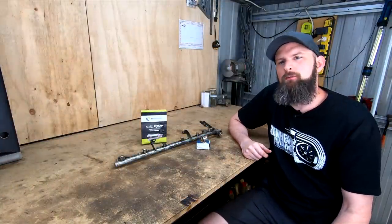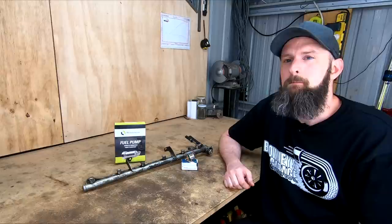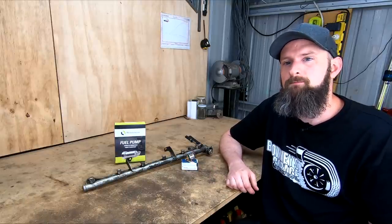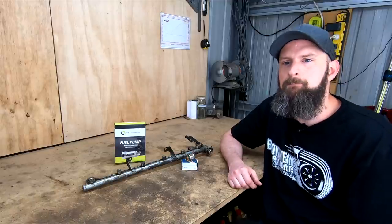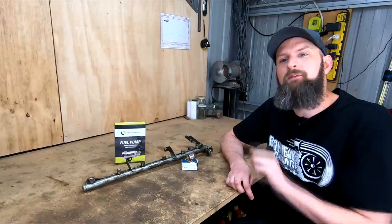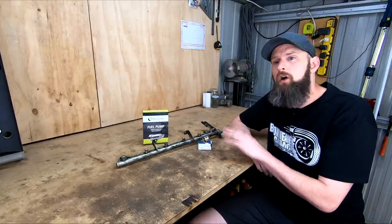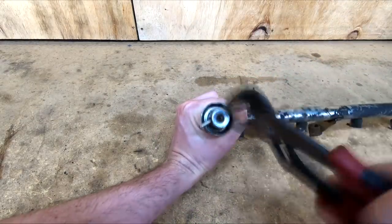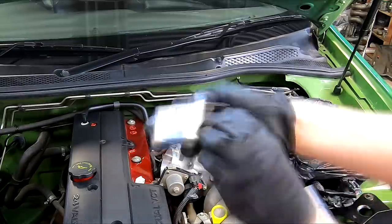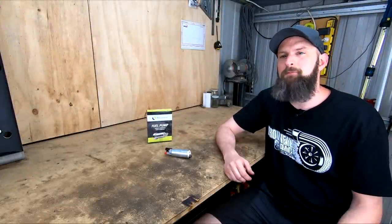This is an area where I've spent a little money on new parts to take some precautions. Without good fuel supply or proper tuning of it, we could pretty quickly lean out the engine and damage it, but it really isn't much that needs to be spent if staying with reasonable power goals. The turbos run a slightly higher fuel pressure due to an upgraded fuel pressure regulator — up to 4 bar from 2.7 in the NA. There's a large clip that goes through here to hold the regulator in, just pull it out. The regulator will likely be pretty stuck, so use some penetrant spray with a bit of twisting to break it free, then work it side to side and lift it out. New one can be pushed in with just a touch of oil to lubricate the seal, and push the clip back on. Rest of the fuel system is dead simple — it's done.